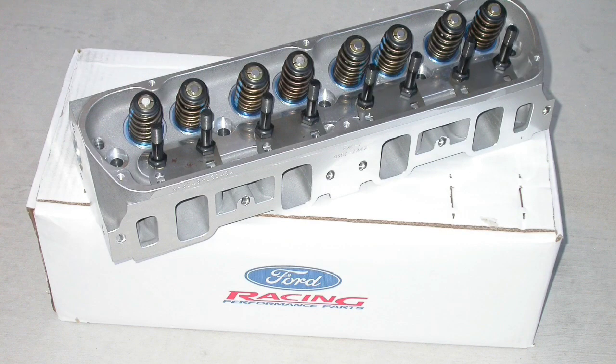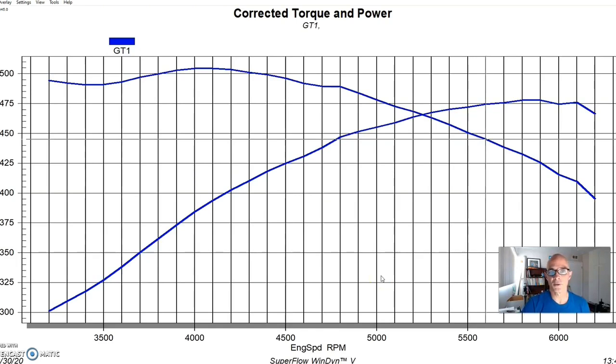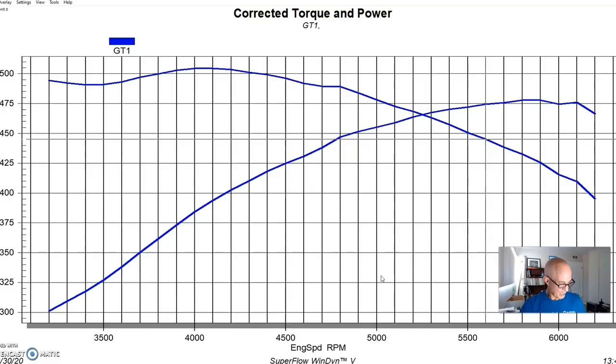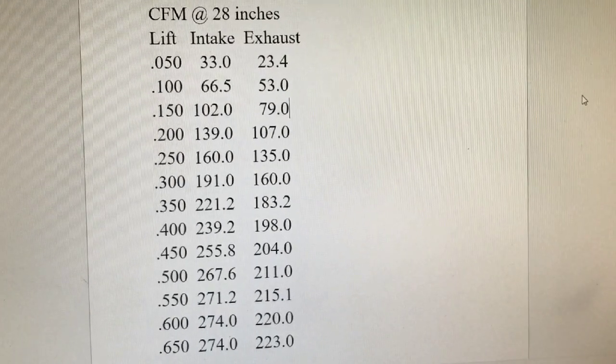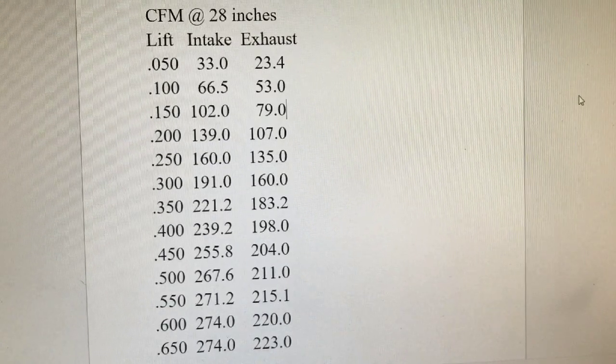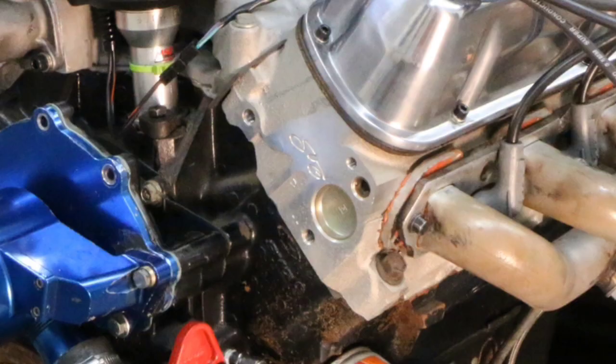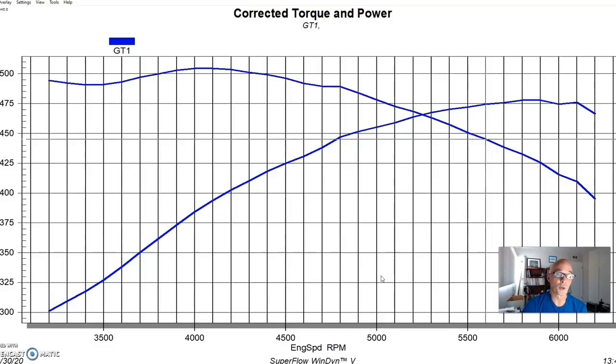After running the nitrous test it was time to swap on the Z304 heads from Ford Racing. This was very early on in testing with those heads — they came incomplete, basically bare, and we had to assemble them and source the valves. We installed a 2.02/1.60 valve package. Ford Racing promised these heads flowed about 275 CFM, so I flow-tested them on the flow bench at West Tech on a 4.030 bore and they were almost spot on — our numbers correlated closely with theirs, though our mid-lift numbers were a little lower, which is just a different bench and tester.